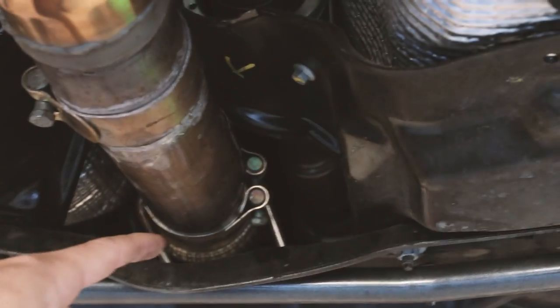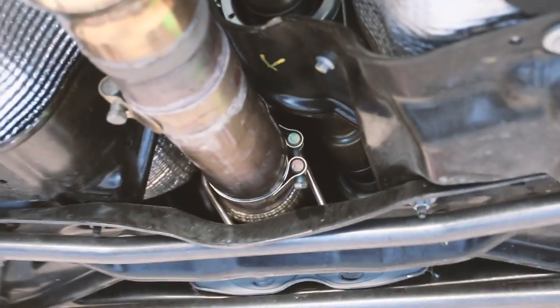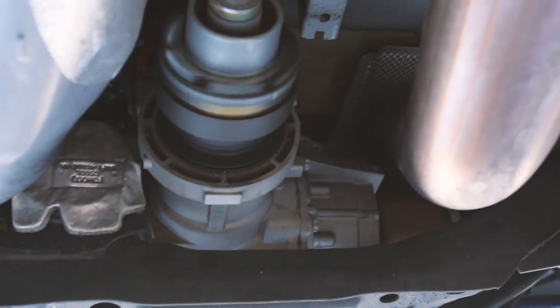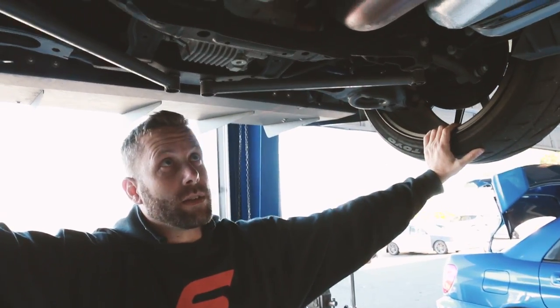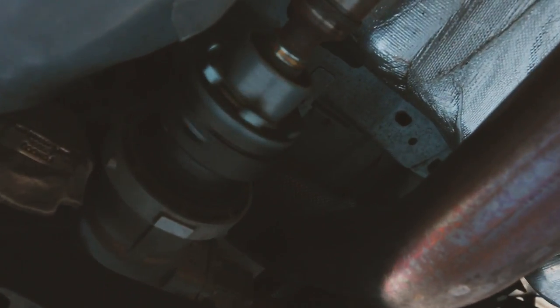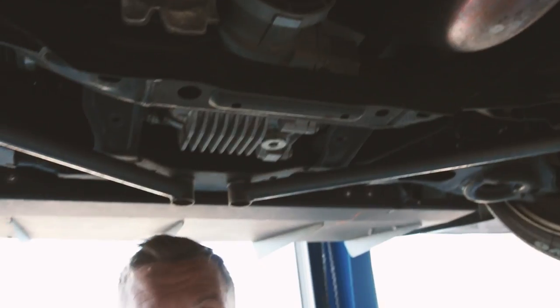So here we go in two-wheel drive mode — PTU's turning the drive shaft, it's also turning the RDU, but obviously you can see the axles aren't moving. As far as people talking about drivetrain loss on the dyno, you're still getting all of it — the car is still turning almost everything except for the axles and the wheels. That's the reason why we have to put Disable RDU on the dyno, but it's also why the car still makes the same amount of power, because you're still getting all of this loss.